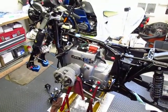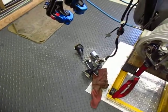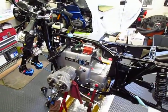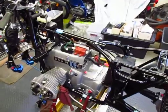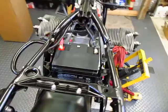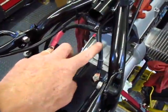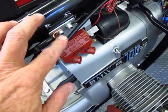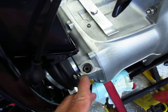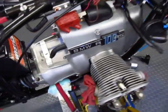I have the electrical system installed and I temporarily installed the fairing harness just to test out everything before I go much further. It's a lot easier to fix problems at this stage. I've got my new battery installed and I decided to route the ground wire up to the frame rather than down here at the speedometer bolt. It puts a lot of stress on that bolt and can strip out, so I like to do it to the frame.